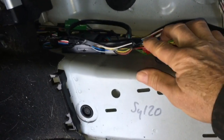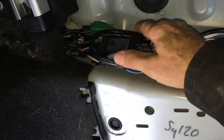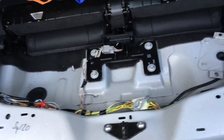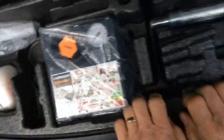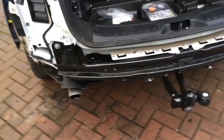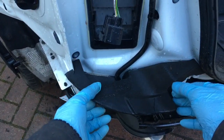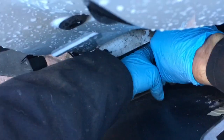Tuck all the wiring out of the way using tape or cable ties to leave room for reassembly. Refit the foam and tool kit, then push the plastic cover back into place. Before fitting the rear bumper, check that the foam rubber pieces are in place — mine had shifted. Once both sides are confirmed, reconnect the connector on the right-hand side making sure it clicks.